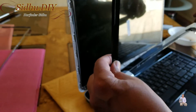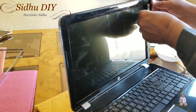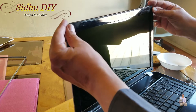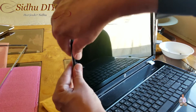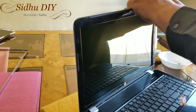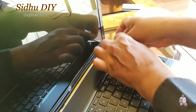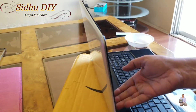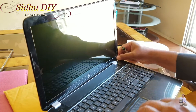This is the bezel — we're going to put it in. The way it goes is push it down like this on the screen. We're going to align it and start from the top where the camera is. Press it in — it's nicely getting pressed in. We're going to go all the way around on the sides. There was one place with a snap and double-sided tape, so we're going to place it on top with the safety cover. It looks nicer.